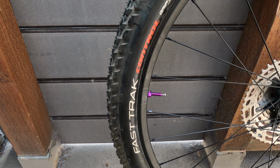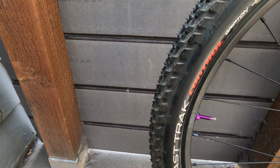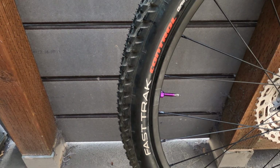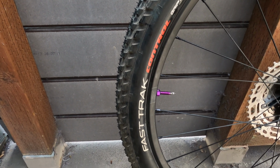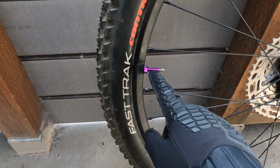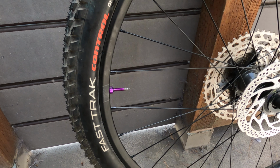So thanks for watching. I will give you guys an update if it continues to leak air overnight. We'll try to find a different solution. If it doesn't, then it was just sealant. So again, check your sealant, check your valve stem, make sure that the bead is clean.